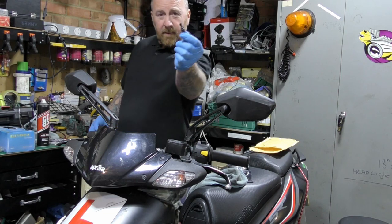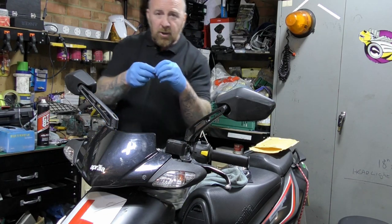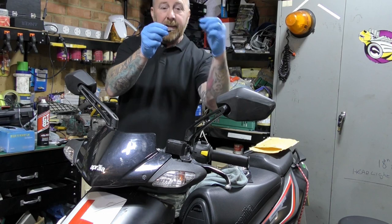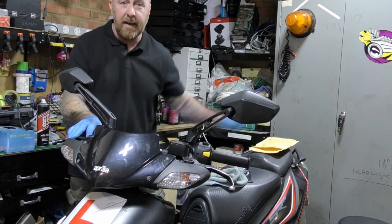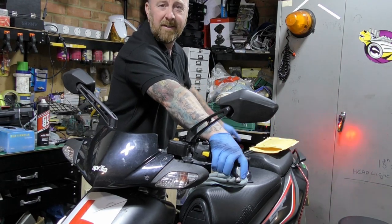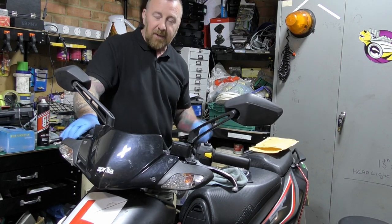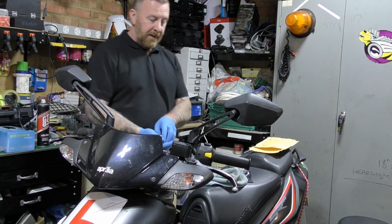So, my little brake switch came. Simple, wind it in. Don't fit the connectors first and wind it in. You're just going to mess up your wires. I know it's a bit more difficult, but wind it in, then connect the wires, and then what you should get, if you look back here, is brake light working on both sides now. And that means it will start on both sides. Remember, it doesn't just do your back light, it does your start as well, because you have to have the brake pulled in to electric start it.